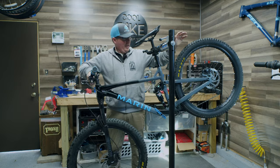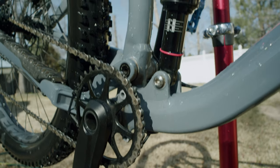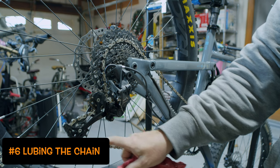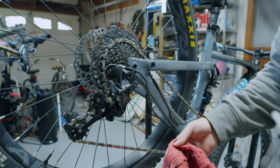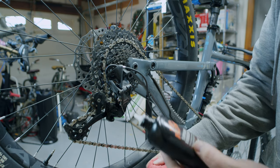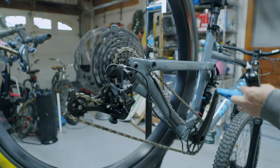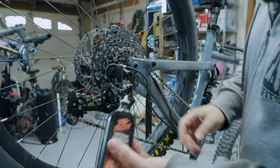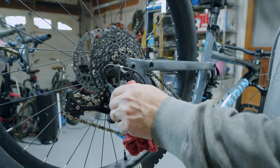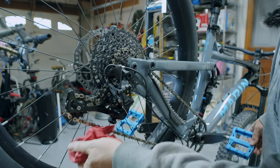Back fresh from our bike wash — now we're going to lube the chain and then check the suspension for proper air pressure and to see if it needs to be cleaned or lubed on the stanchions. This was a brand new chain I put on before my last ride and it had a little waxy buildup from the manufacturing packaging, so I'm going to add a little wet lube to work its way inside the individual rollers. I know wet versus dry lube can be controversial, but for this I want a light wet lube. I'll drop it into a harder gear, rotate the bike backwards while applying lube to the chain, rotate about five or six turns to let it work through, then wipe off the excess — including lightly on the sides.